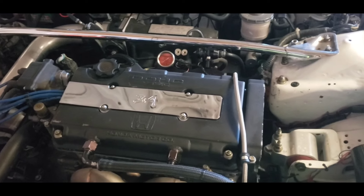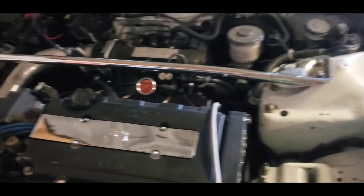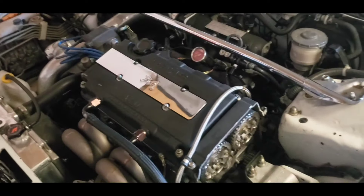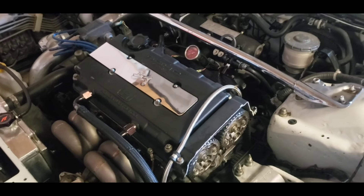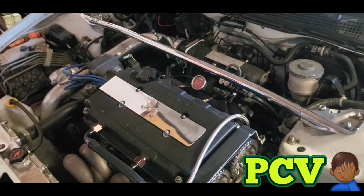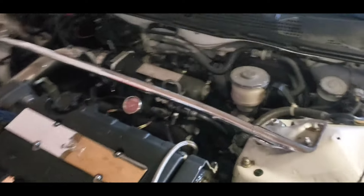So I said I want to put on my polished valve cover because it just looks so good. So I put on my polished valve cover because I knew I could vent from the back of the block. They sell these kits where it comes with fittings — you take the plugs out the back of the block and you can insert those fittings. They also have a plug that comes with it so you can actually plug where the PCV comes in. It's like a black box — those who know Hondas know what I'm talking about — you can plug that hole off.